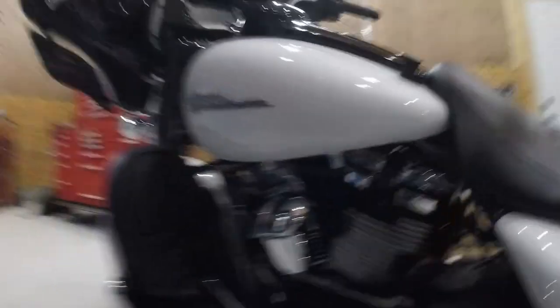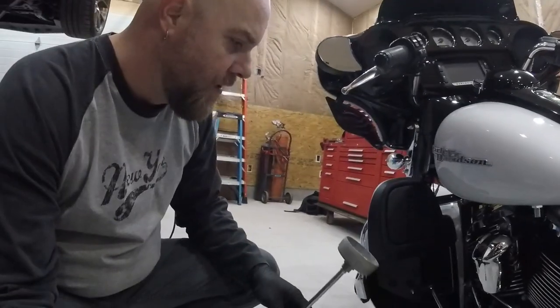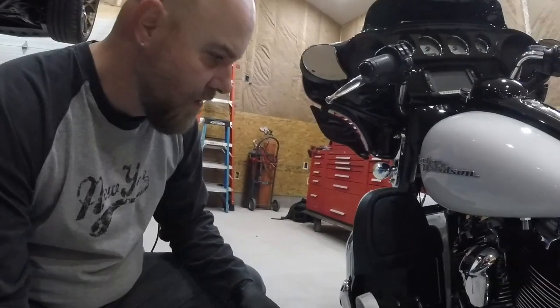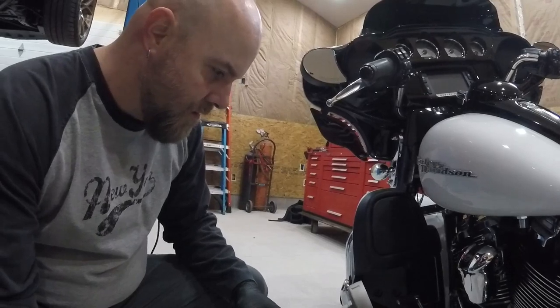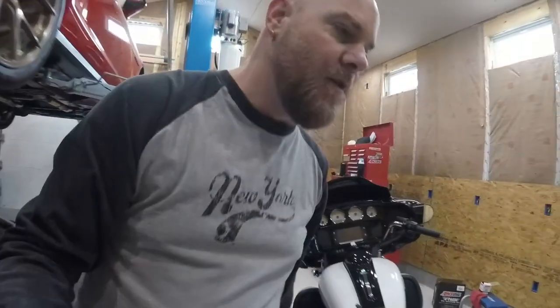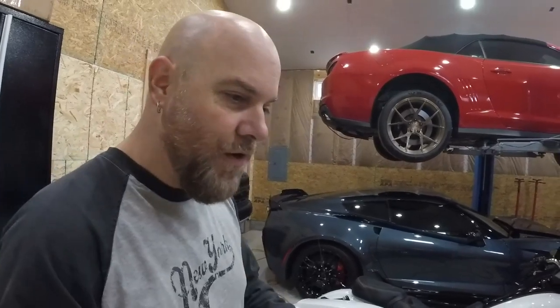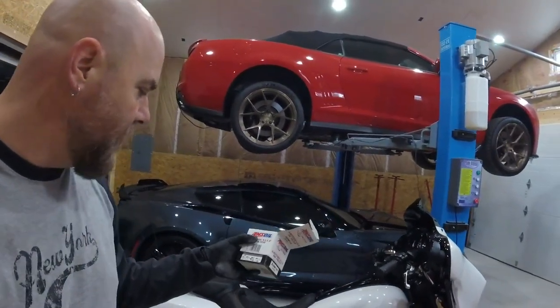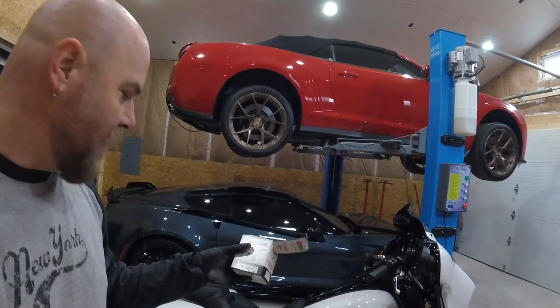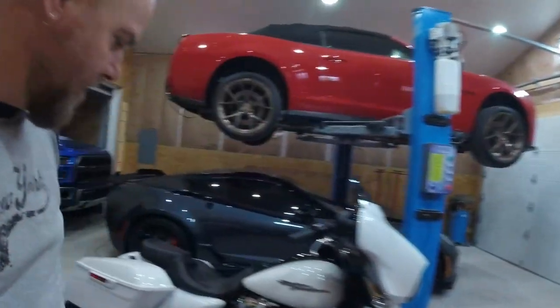The oil filter is right up front there, and we got the wrench for it. I'll probably put tape or a rag around the new filter to stop the wrench from damaging it, since this is a range-style wrench rather than an exact-size one. I really don't want to scratch up the new one. The new filter came with an o-ring in the box. I'll put a little bit of oil in the filter — maybe a quarter quart — and let's get the oil drain first.